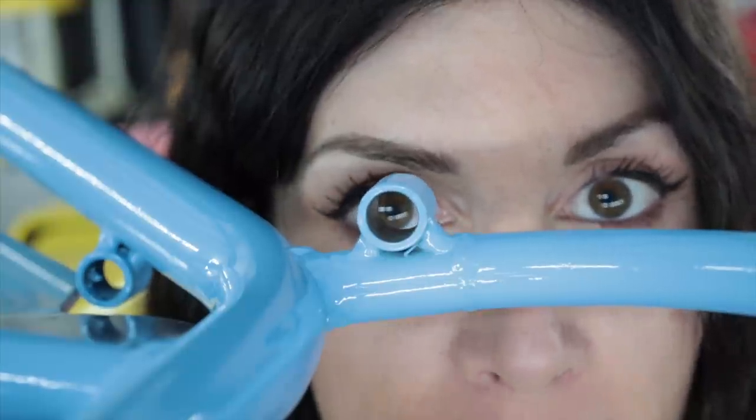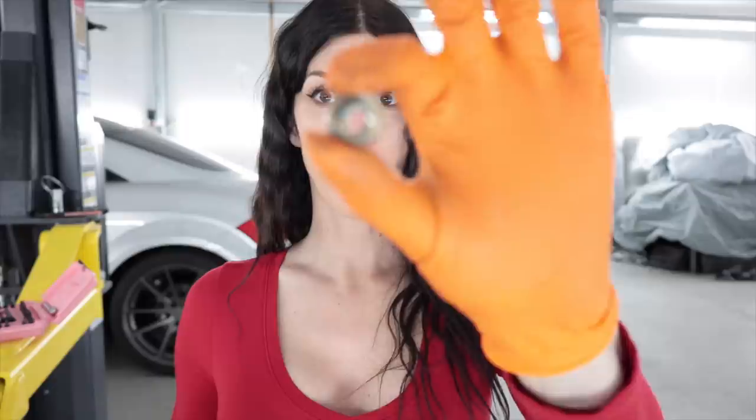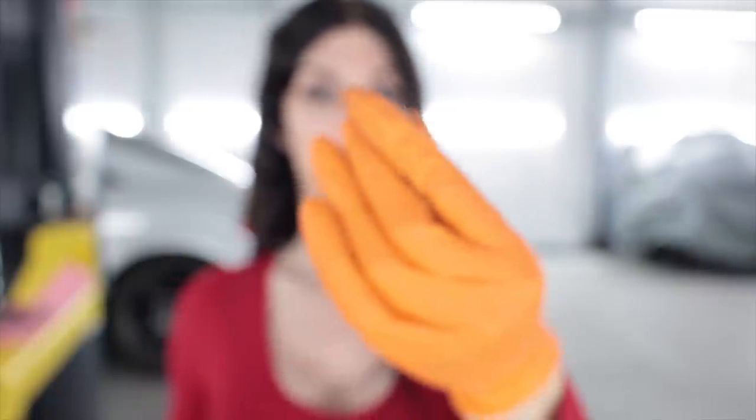This little tube right here welded to the frame is where the throttle and the brake pedal go. Before, instead of bushings in there, it had globs of masking tape, which is a creative solution in a pinch. However, these right here — focus — are little brass bushings that should be in there, one on either side. They're shouldered. However, I could not find them in the correct size, but I found these. They don't have a shoulder on the side, but it doesn't matter because I have washers that can serve that purpose.